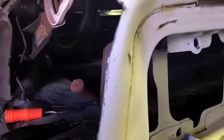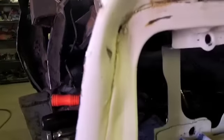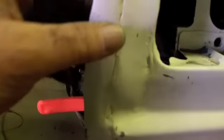If that doesn't work out, I have a piece of a quarter panel I cut off another car — my old car — that I think has that piece in good shape, and I can weld it on here and then do the skin the way I had planned.